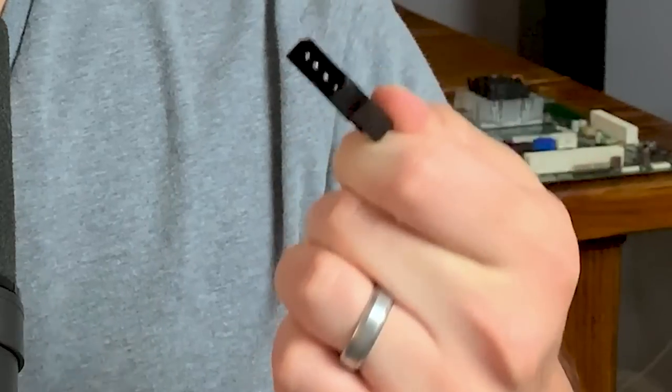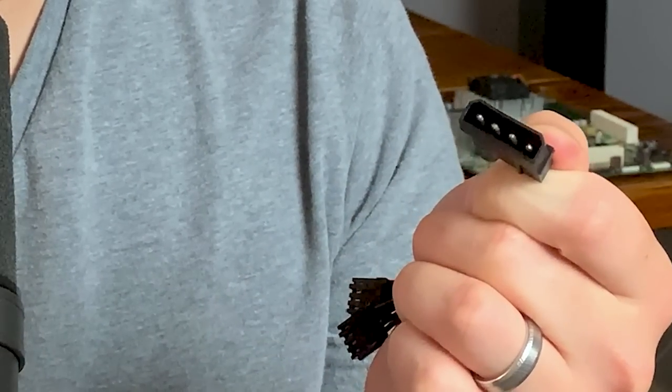Oh, do I have a power supply around here? Okay, well, I just pulled this little adapter out of a box, but basically one of the Molex pins on the fan connectors on those Antec fans, one of these connectors, it sort of slipped out, and I think it actually shorted on the case because the NAS was fine, and then when I tinkered around, when I had to replace the PCIe card that also failed, I think the fan header moved enough to where that little pin that had poked out shorted to ground.